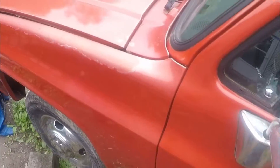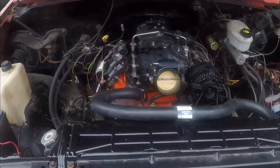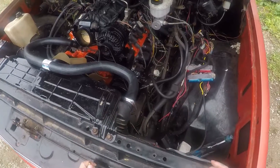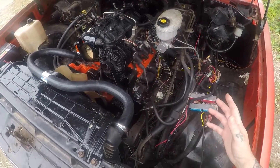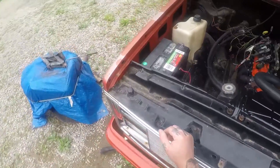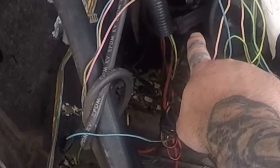All great how-to videos start with a Chevy — just saying. Take a look at this LS swap. The temperature sensor location will depend on your placement of your heads, because sometimes you can re-use them. But most of the time the temperature sensor is always on the driver side right here. That's especially true on these LS swaps, but you can relocate it. Factory, they're over here, but sometimes you will see them on the passenger side on the back right there.